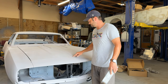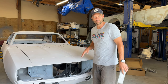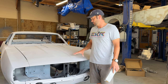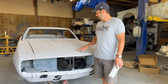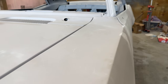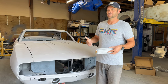So we've got our part here where this hood edge is higher than this little front filler panel thing. Here it looks fine probably from your view, but if you look down on some cool B-roll, you'll see this is higher, and that's just because this is a brand new piece. Previous piece had a big dent in it. We got a new piece that's straight and ready to go. That's one of those bolt-ons — not always bolt-on — and where we kind of come in to fix some of those things. So we'll finesse this up a little bit to get this crest perfectly down so that when you look down this line, it's going to be perfect. We're just doing that a few places here and there — pretty much where body lines line up, where a fender lines up to a door, where the trunk door lines up to the edges in the back.